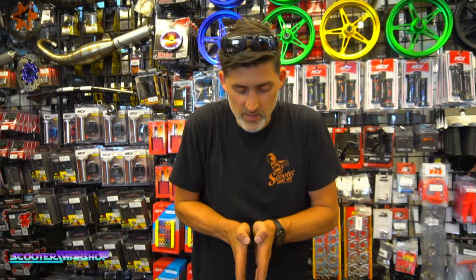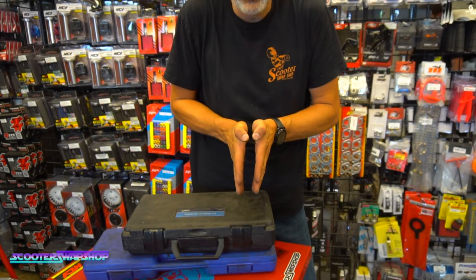And I can't stress enough, if you guys are putting engines together, don't hammer them, don't press them. A lot of people will press the cases together in a two-stroke, and you're basically binding the two center sections of the crank, right? Because you've got the pin in the bottom. You push it, and you're going to bend that crank, and then it's going to stay in that position. You may not be able to see it with your eye, but if you press a motor together, take a look down there, and I guarantee when you see it spin around, you're going to see the crank going in and out, and eventually it'll tear itself apart. So keep that in mind. You want to put everything together with the least amount of stress possible.